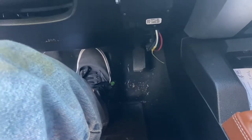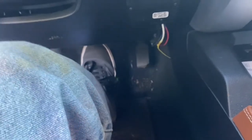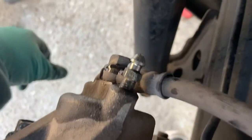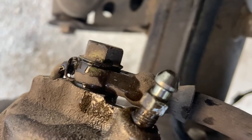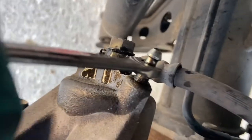Right before putting the wheel back on, extend the caliper so it's nice and tight against the pads. Then crack the bleeder screw open just a little bit, not fully, just loosen it to let any fluid come out in a nice stream. No air bubbles — that's what we want. Go ahead and tighten the bleeder back up and wipe it down with a rag.